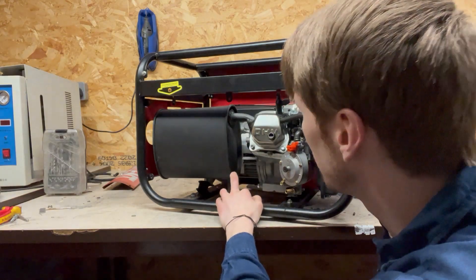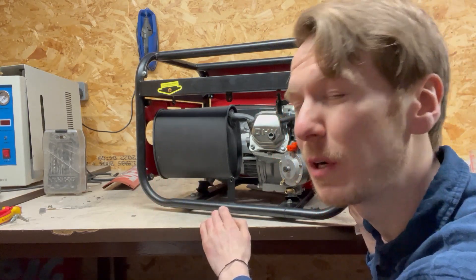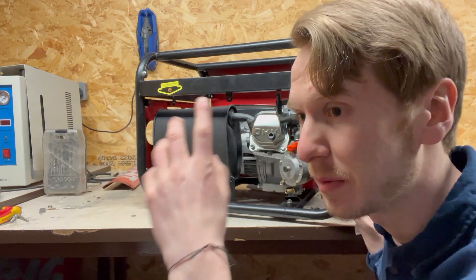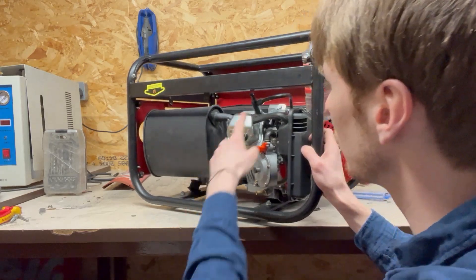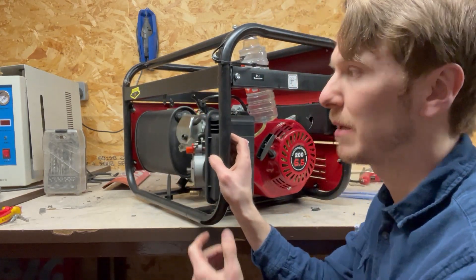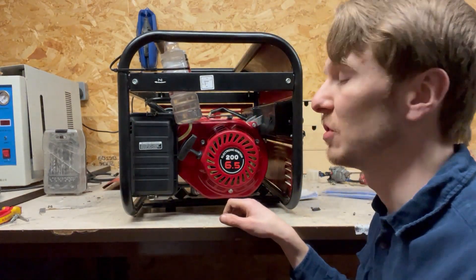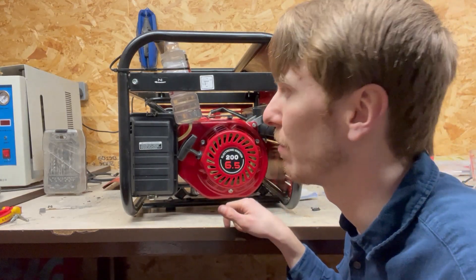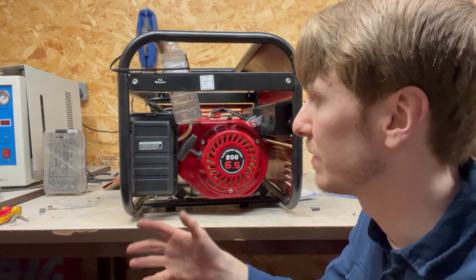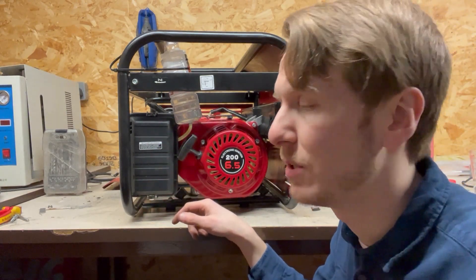On the whole, the engine is running, performing, and generating power with no carbon emissions — or very, very little. You will get a little bit of oil seeping past the piston rings or through the oil breather. You could deploy a small catch can to bring those carbon emissions down even further. From the hydrogen itself, it's producing zero carbon emissions. There's just a little bit of NOx from the air, which can be eliminated or reduced with a catalytic converter, and it's also reduced by running a very rich hydrogen mixture with limited air intake, plus water cooling to bring exhaust gas temperatures down.